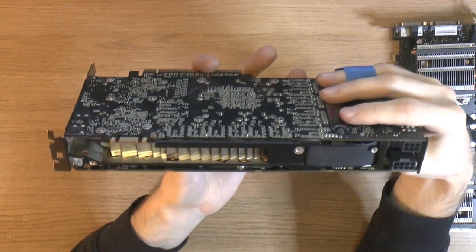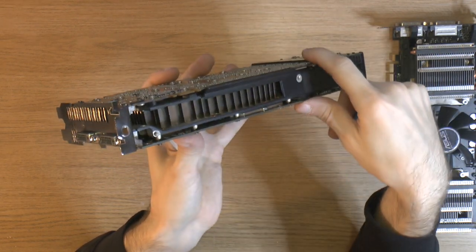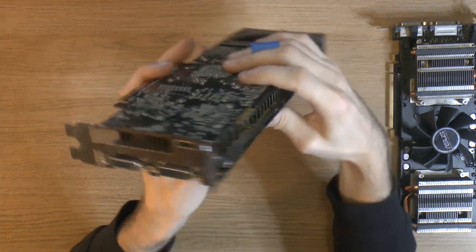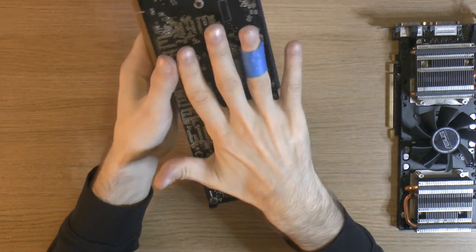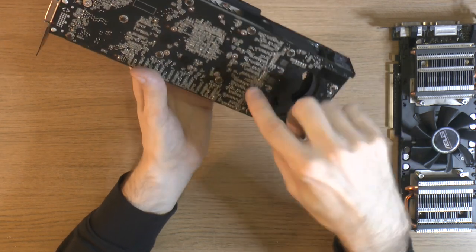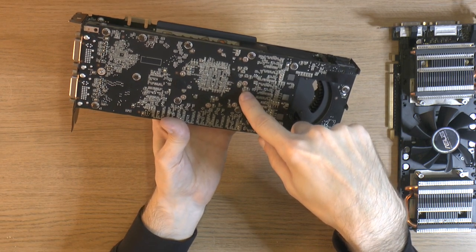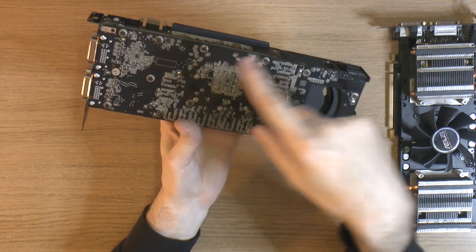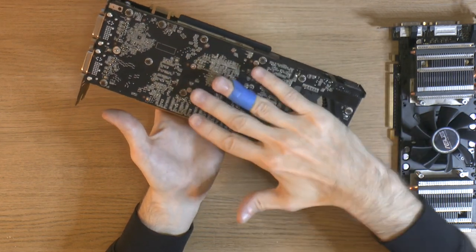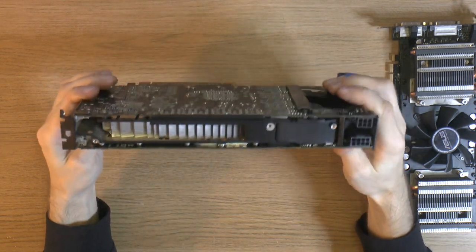The main fault, I think, is if you just look at the design here, the kind of white spacing on them, and they have to do that because they decided to blow some air out here and some here. So the fins are stacked like so instead of being parallel. So the gap is kind of narrow here where the fan is and the spacing between the fins, but it gets progressively bigger. So they could have added more fins if they had all gone this way, I think. It would have been better. But it is what it is.